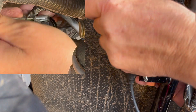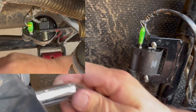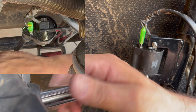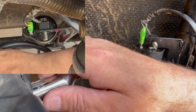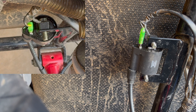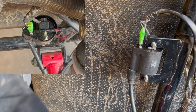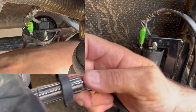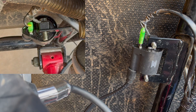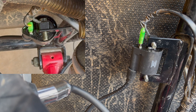And there you go. Once you've got that connected, go ahead and connect up your plug wire. Once you've got that on, go ahead and connect your battery. Disconnect your battery charger first, then simply connect your battery — which is real easy. I just disconnected the negative side.